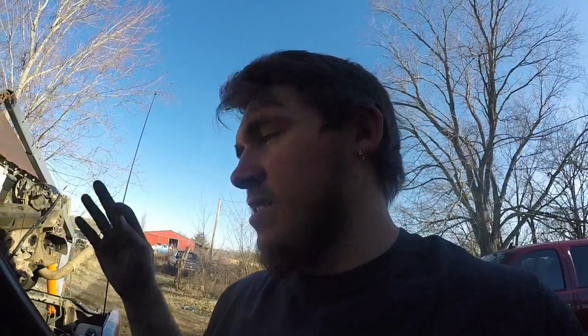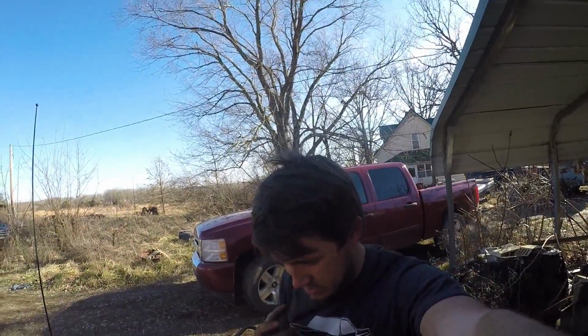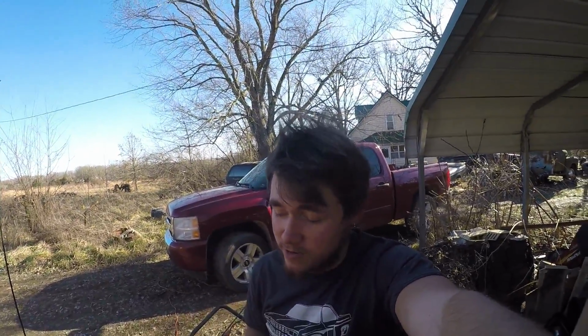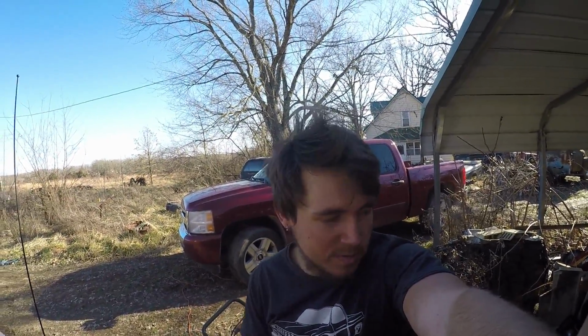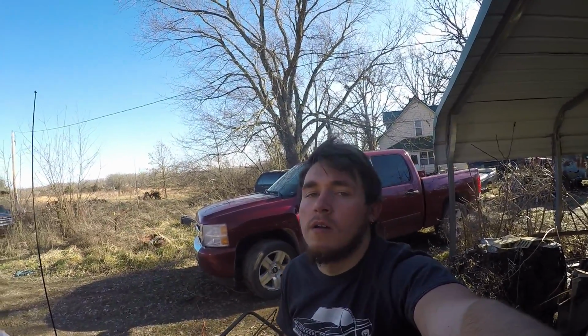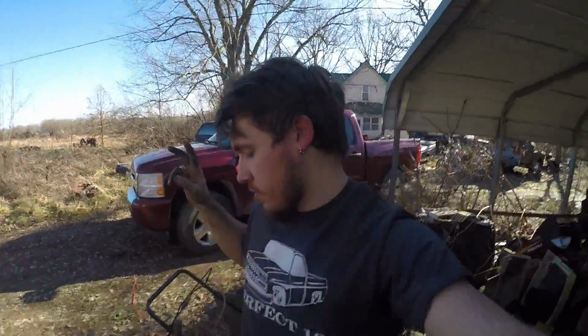This is gonna be a really long video for y'all because I'm probably not gonna cut down a whole lot, because I want this to be a how-to video. Granted, the way we pulled this apart, I wouldn't recommend doing it that way, by cutting a giant hole in your floor to get your tranny bolts. But I didn't feel like pulling out the cross members, like the torsion bar and the transmission cross member, just to get to my bell housing bolt, so I just cut a hole, which has gotten much bigger. But we'll patch it up to an extent.